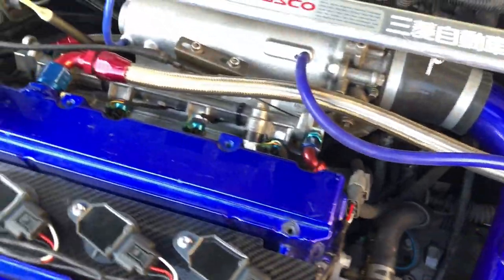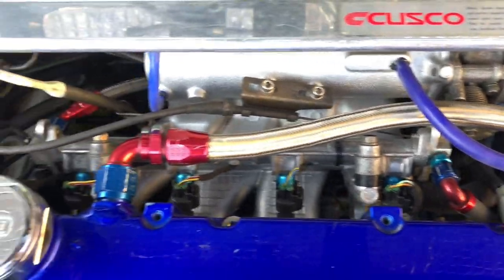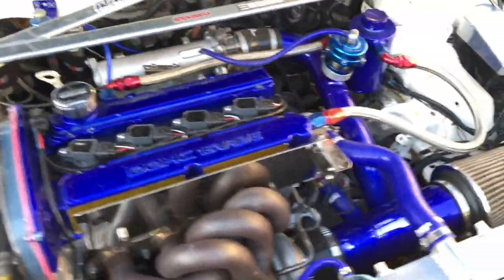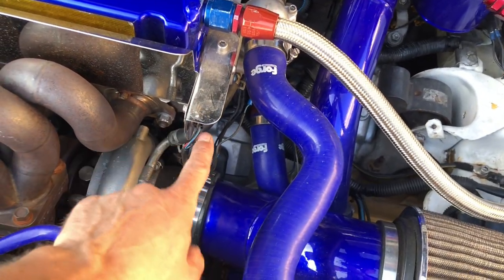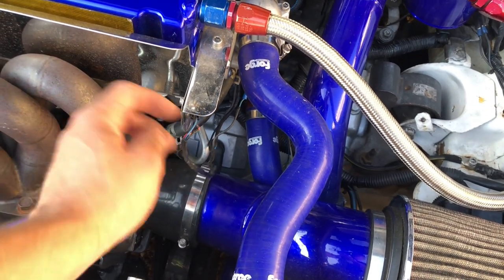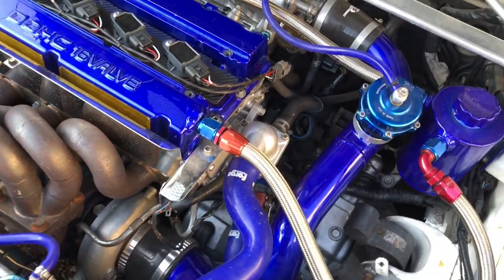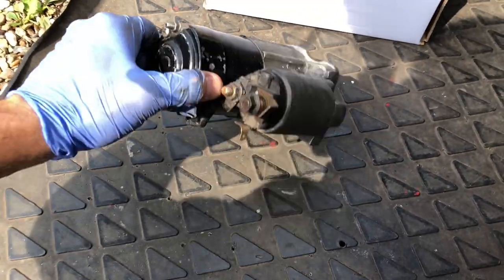I've just tucked all that wiring down the back of the inlet manifold. You can see it's tucked underneath the fuel rail now, just little pigtails coming up for the injectors and coil packs - everything is nice and tidy down there, all cable tied up. That's a lot better than it was. I've left the cam sensor wiring for now because I've got a new plug coming. I damaged this one when I was probing it during the cam trigger diagnosis, so I'll leave that one uncoated so I can solder it when the plug arrives.